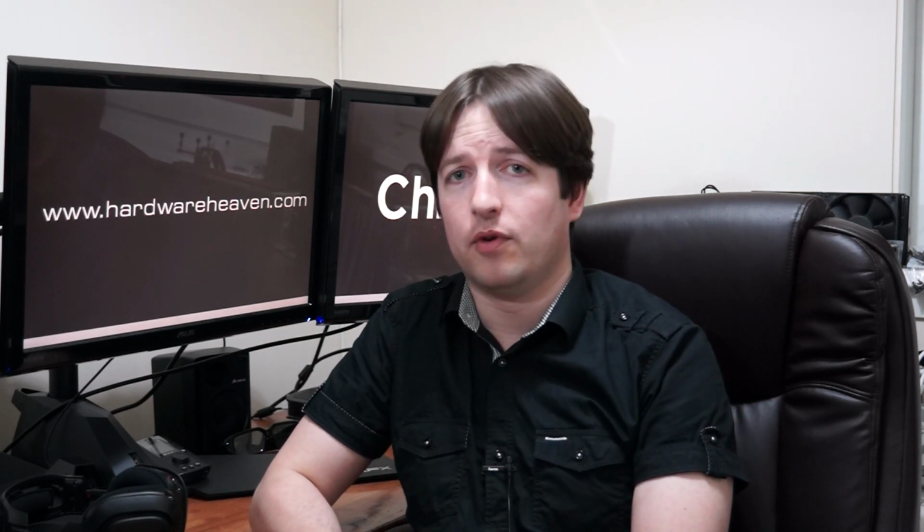I'm Stuart and today we're going to be taking a look at the latest PC from Chillblast. It's the Fusion Tiger Shark. Now this is an Intel Haswell PC, so the most up-to-date range of processors. It's based on an i5-4670K, and instead of running it just at the stock speed, Chillblast have taken the time to overclock it at their factory before sending it out, so we're running it over 4 GHz on the CPU out of the box.